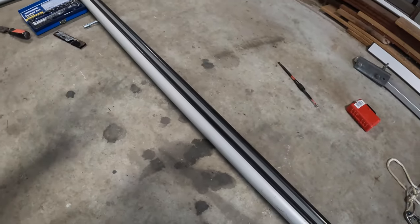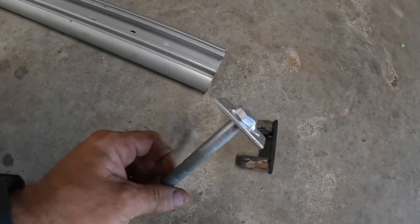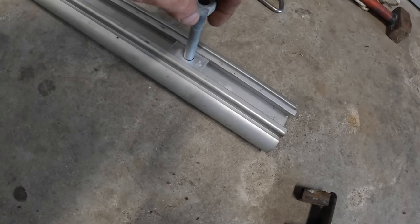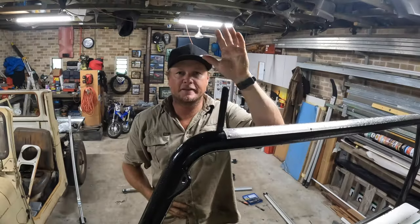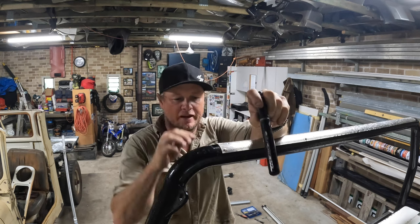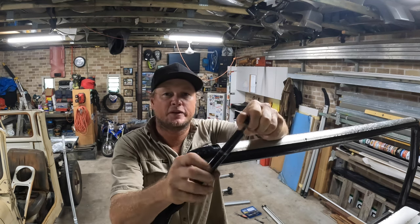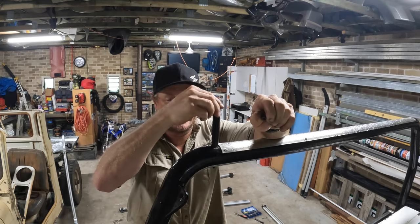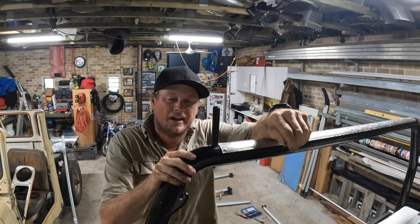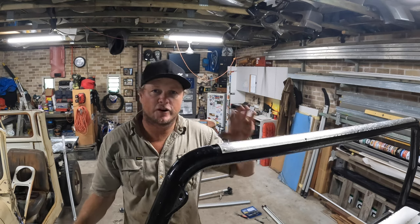This is one of the rails that the actual boat sits on. They have these plastic end caps in them - they just knock out, they're just pushed in. These are the bolts I've come up with that slide inside this channel. Imagine that this track is upside down - it will go down through the original hole where the pins go on the Triple M trays. These are those pins - already undone the nut at the bottom. Pin itself is 16mm, the bolt coming through the end is 8mm. We have a 16mm in the top and 8mm underneath, so we'll have to enlarge that hole to 12.5mm, which means we'll still be able to put these back in and use them just like they are now.